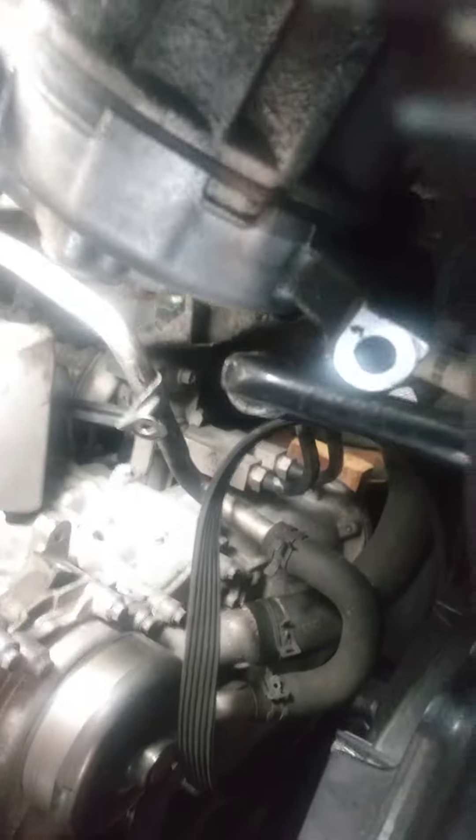2016 Charger engine mount — I just pulled it off. As the first video showed, you take the compressor off: two studs on the bottom of the compressor, four bolts, and the belt, then the whole thing moves to the side. Of course the airbox has to be out as well.